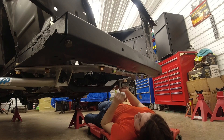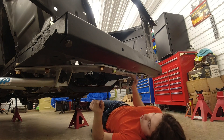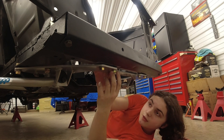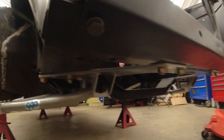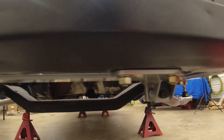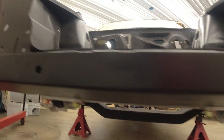We got the lower control arms in now. They were quite a bit of a fight to get in there, especially this one. But now we're down to the last step, which is just tightening down all this hardware. Remember, this hardware doesn't have lock washers on it right now because we're just mocking up the front suspension. I got all the bolts tightened up now, meaning the crossmember is all in place. So that's where we're going to end this video today. Thank you guys so much for watching — we will see you next time.